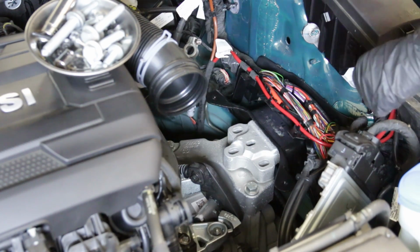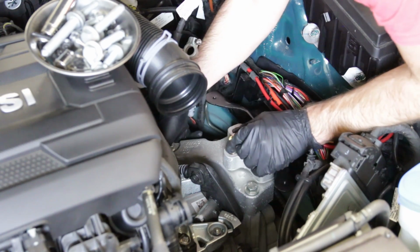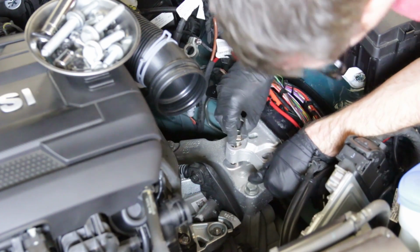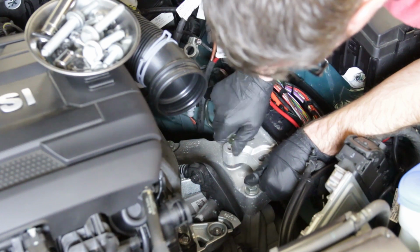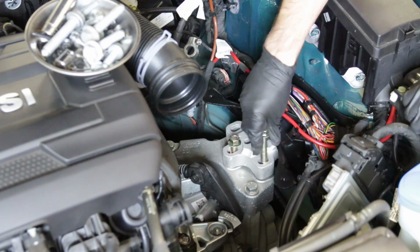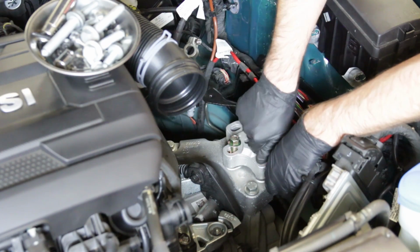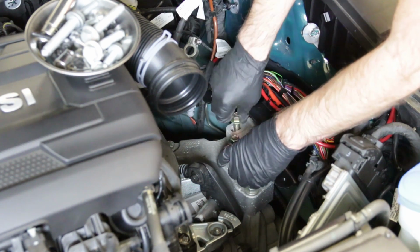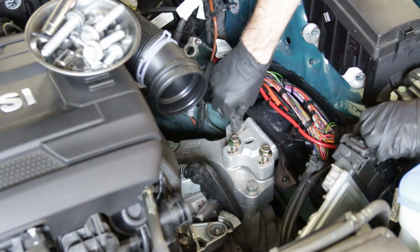Now we are going to get this trans bolted in place. Now the one thing you have here is, because this stuff shifts around, you may want to just lift this thing up and get these bolts threaded in place first, because otherwise you may struggle with getting them in, and maybe we can worry about the alignment pins after the fact. Once we get them threaded in place a little bit, you can give the trans a little wiggle to get everything sitting down where it belongs.